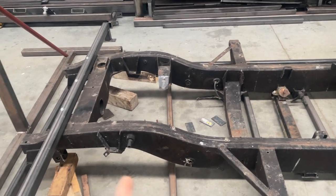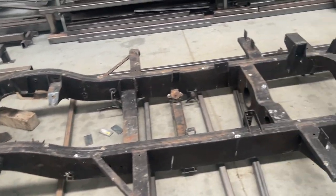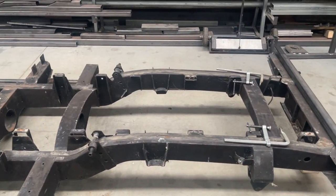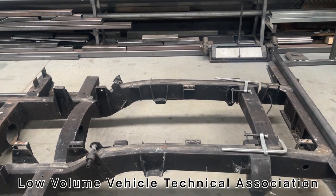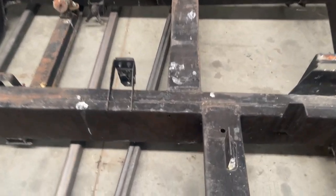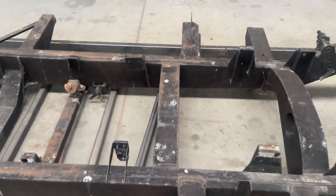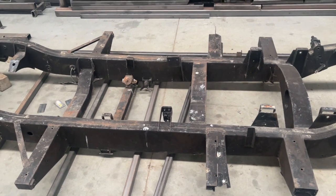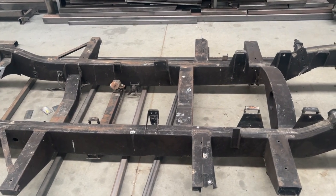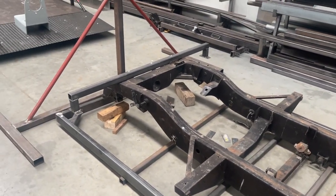We're considering where we'll limit those drawings so that we can offer a front cutout for those that want to do repairs, and a rear cutout. We will be speaking with the LVVTA people to see whether they think we can get away with building a chassis in two parts and putting the join through here with a fish plate on it, with that centre component helping us bring the strength back into the chassis. That's an option — it's been done elsewhere and it works very well. That's where we're up to today, and I'll follow up more with you as we begin the jig completion process.